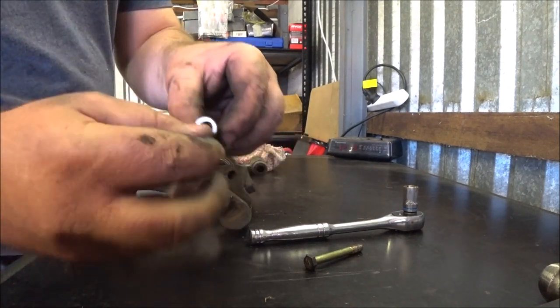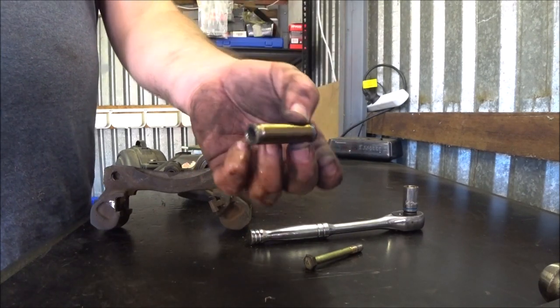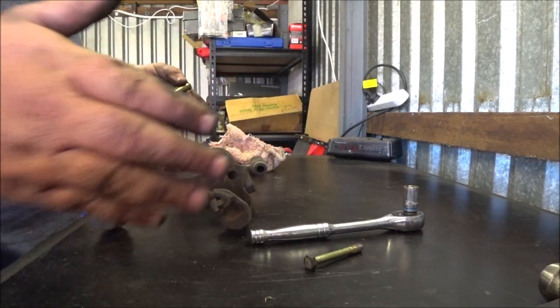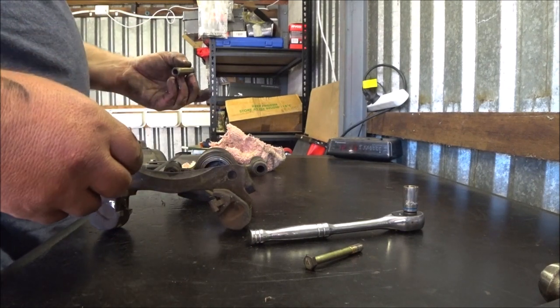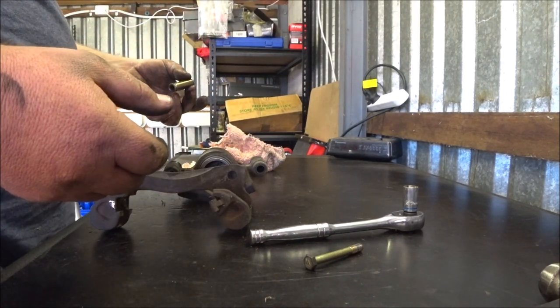So this one, obviously the bolt goes through the middle. There's a bit of debris in there, but not a lot. I'll flush it out with some WD and reassemble it and just give it a few cycles. And then if it's free, reinstall and bleed the brakes, because maybe it was air trapped somewhere. Obviously I got to bleed them because I've undone the nipple anyway.